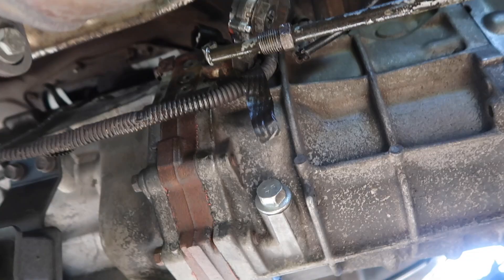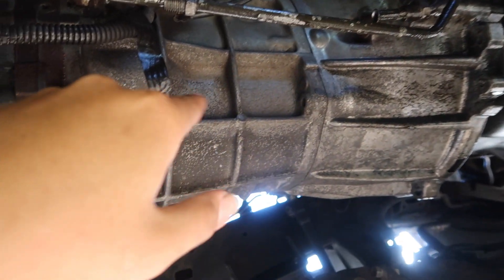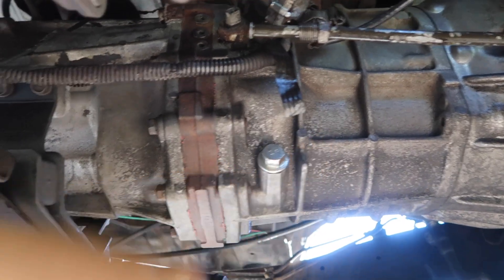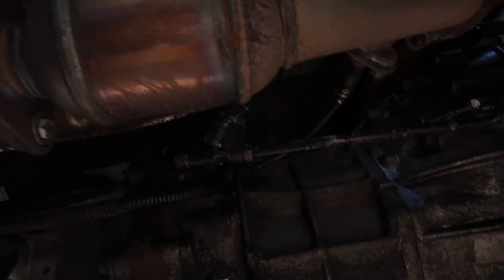The only thing about doing this is that you'll be stuck with a check engine light, because you have an automatic ECU and you no longer have the torque converter or other stuff that the ECU reads on the automatic trans. I haven't figured out how to trick those sensors to remove the CEL yet. If you're fine with a check engine light for now, this is the easiest route. You can also remove the bulb, and I have an ultra gauge in my truck so I can still get alerts.